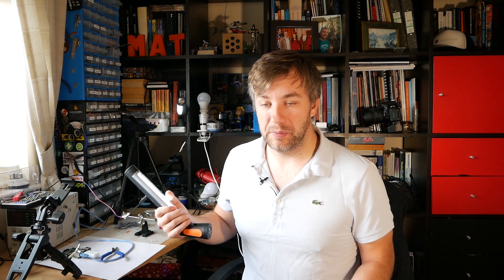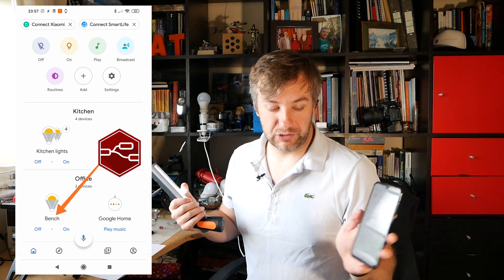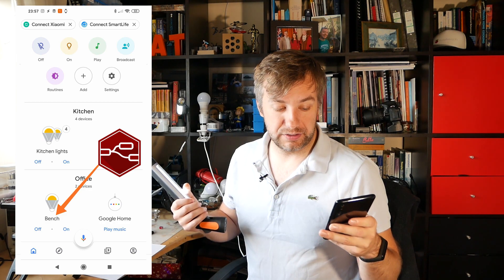Winter is coming. Now, I would be able to set up simple controls via IFTTT using Google Home. However, I would not be able to query the temperature and do similar stuff, so something else was needed. And thanks to G Bridge, I'm able to not only control the devices easily, just with a simple couple of nodes in Node-RED and the G Bridge service in the Google Home app — the device itself is listed in Google Home, so I can control it from the Google Home screen.